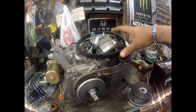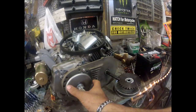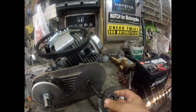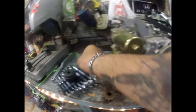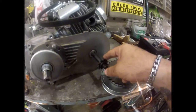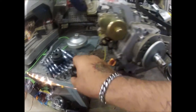We're getting ready to get started on this motor — going to build a hot rod. I'm starting with a 420cc motor. I've torn apart the entire torque converter here. My goal was to get this gear off — it's a 10-tooth gear that slides right on the shaft with a little key that keeps the gear from turning. It turns the shaft, and this belt turns this pulley, turns that belt, turns this gear, which spins the rear end.